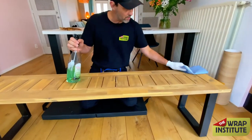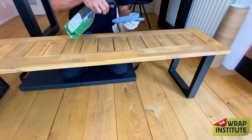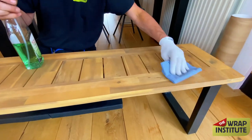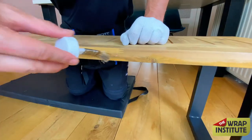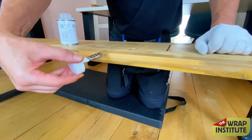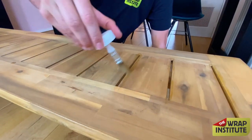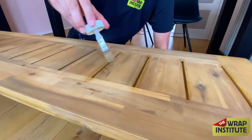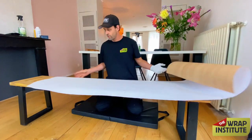Let's get to prep — it's all about cleaning. Be super thorough, making sure the underside is clean and all those little open edges in the slats are done. Take your time. Then add adhesive promoter — it's a slightly sealed surface so use one with a solvent in it, making sure you get full 360s on the outside, underside, and in between the slats. Allow it to dry fully.